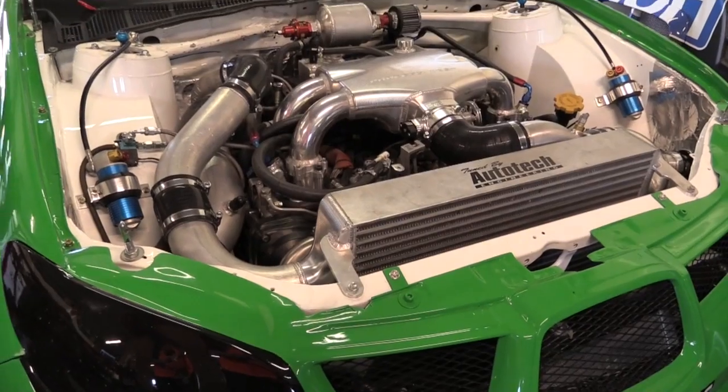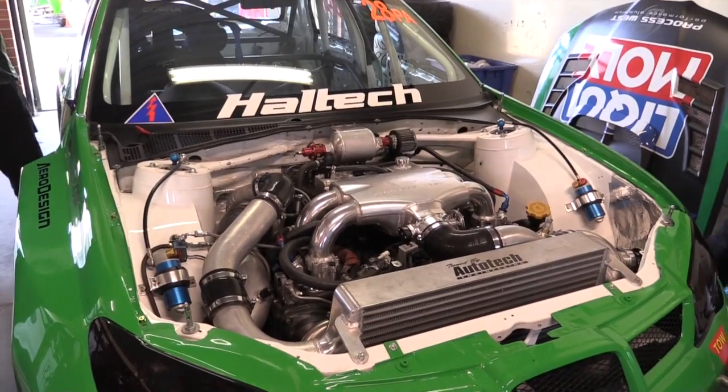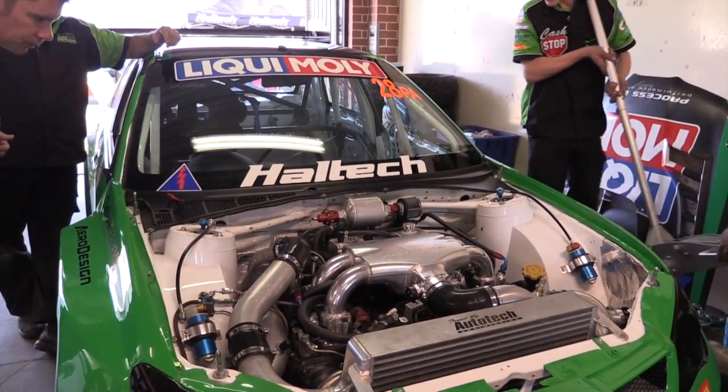So the engine — what have you done there, and what sort of power and boost are you running? That's a pretty complex setup, because Subaru engines with big boost just don't like to stay together. The 2.5-litre has a really thin cylinder wall, so with big boost and big power they tend to spread. We spent a lot of time developing a closed-decking system on top of the block to keep it together. We generally make 800 horsepower at peak boost — we run 40 psi tapering back to about 34–35 psi, producing 460–470 kilowatts at all four wheels.